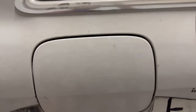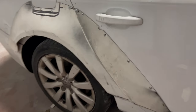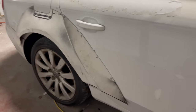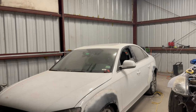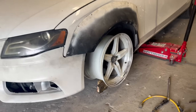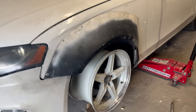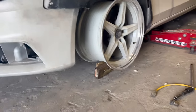If you can change my mind, go down in the comments and let me know. Right here you can tell — we ended up cutting the mold where the gas cap comes in. Obviously we've got to fiberglass and mold it to the necessary shape. This part is supposed to go back in so we've got to figure out how we're going to do that. I came to the conclusion that we have to use these as a mold. We definitely need some spacers too — the bolt pattern is a little different. The wheels are at 120 and the car itself is 112, so we definitely need spacers. You can barely see them in there but they look good.